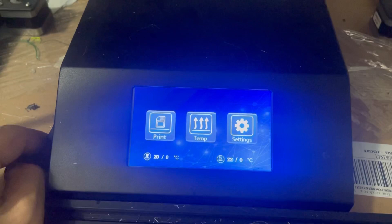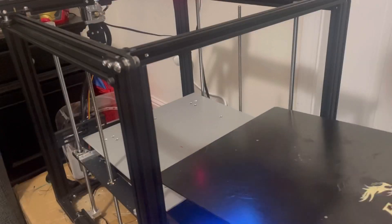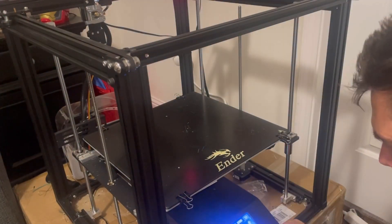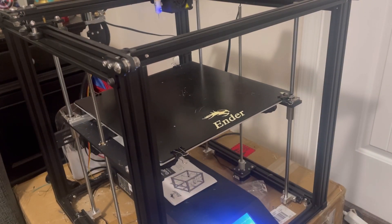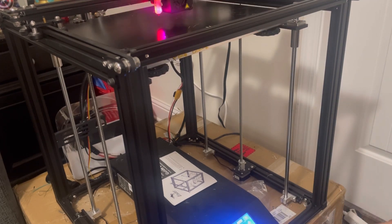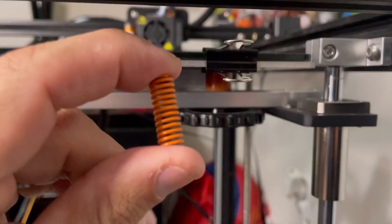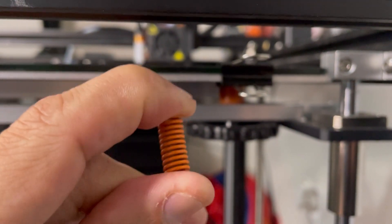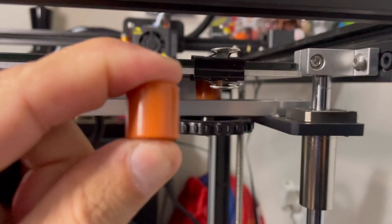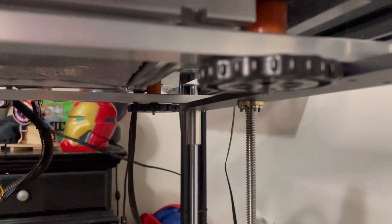Fire up your machine, and whenever you're leveling your bed you always want to preheat the bed. Put your glass bed in place — whichever side you use, whether it be the glass side or the texture side. Get your clips in place so the glass bed doesn't slide around, and then begin the bed leveling process. Here you can see the bed mounts installed — comparing the old factory springs to the new mounts. Look how squishy and how easy those springs bend. The silicone mounts are nice and stiff. Your bed's not going to adjust or come loose.